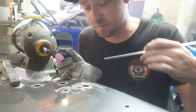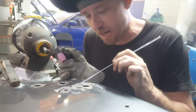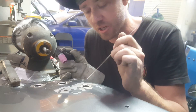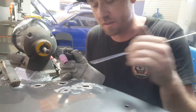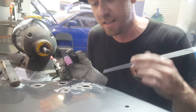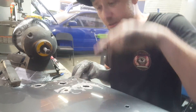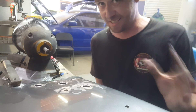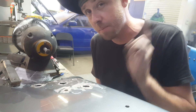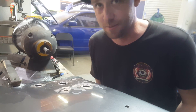There's almost no getting around the fact that this metal is going to warp, but the best thing you can do is build up an edge around the hole. That way I can cut a slug, get one inside to patch it up, and we have enough metal to work with so the hole doesn't burn away. To minimize warping, as soon as I get one hole done, I'm going to wait a good 10 to 15 minutes before attacking any other holes. It's going to take forever, yes, but we don't want this thing to get all wavy. So you have to be patient.